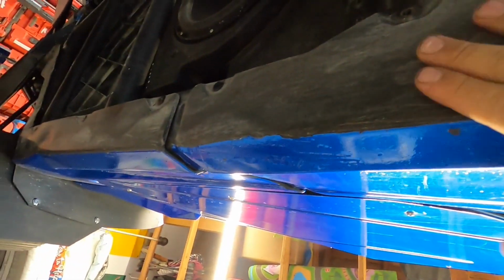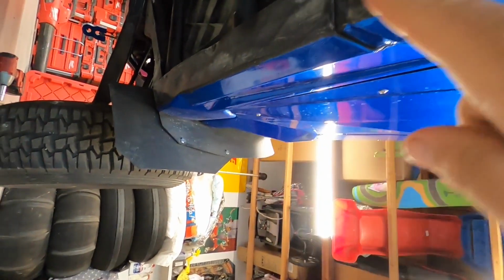All right, guys, we have to install the 6 rivets on each side that hold the side panels, and it's very simple. The locations are really easy. They're the only holes that are not lined up with an actual frame tube that goes across. So there's 2 here, there's 1 here, there's 2, and then there's another one between the first and second tube.